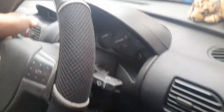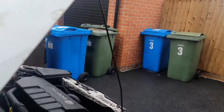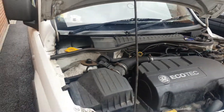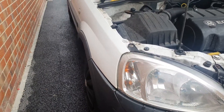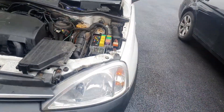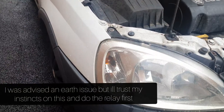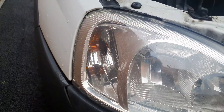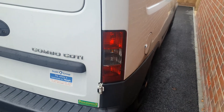One other thing to note is when I put my hazards on, they do work but it looks like there's a kind of lack of power — just flickering — whereas the other side's fine. Really intermittent flashing. I'm going to take a gamble and try the relay switch.